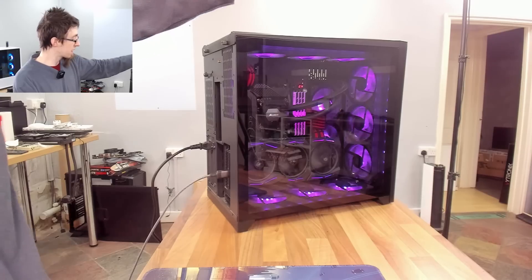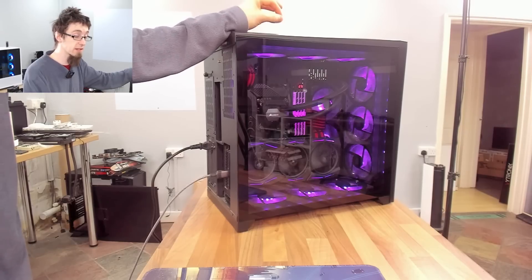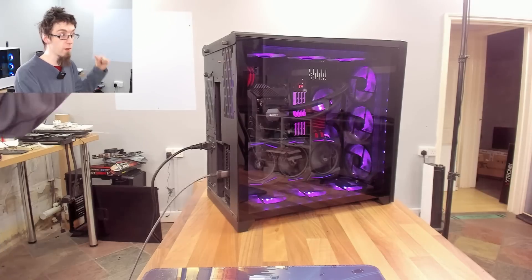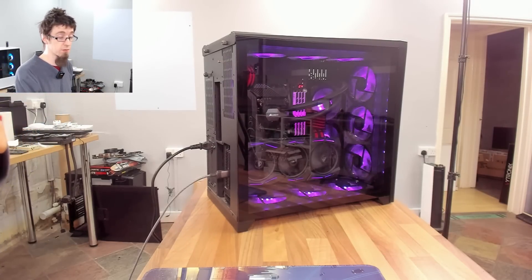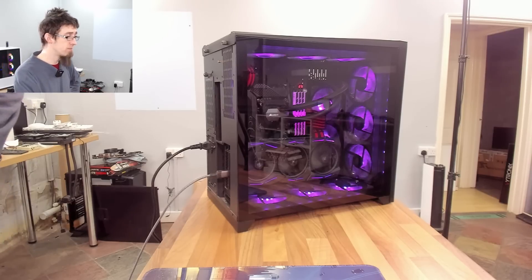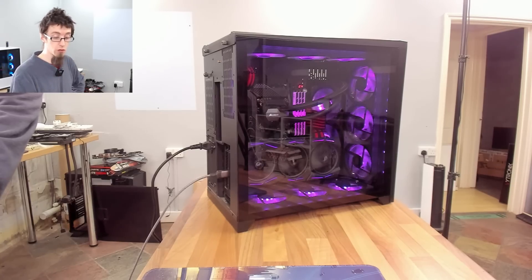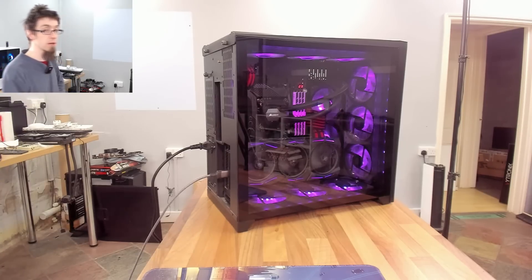So what I'm going to do is take this thing apart, get the motherboard out, and do a single pin replacement on that header. I don't think this repair is going to be particularly difficult. I've done a quick test run to remove a pin from a donor motherboard so I could check what I was up against. The hardest bit is just removing the plastic bit from around the header. We'll also look at what has happened and what other options you've got to avoid this happening to your computer.